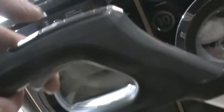This is the cleaning station. If you want to do it this way instead, you basically just put that on the floor. That just slots in there. What this does now is that the roller is higher, so you're able to press the trigger, clean the roller, and it sucks the water in. So I'll show you how to do that. You just release it so that the roller can spin, press it so it's on high mode, which is probably better, pull the trigger, and now that's clean.